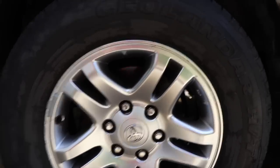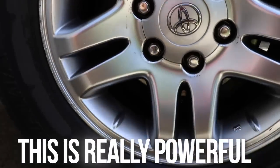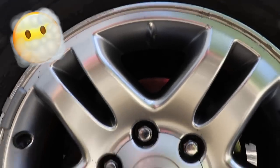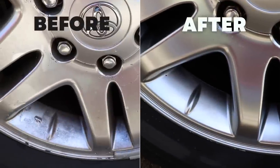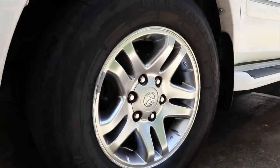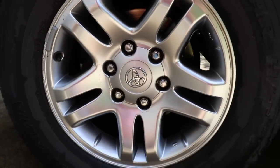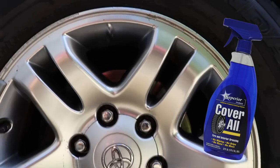Looking at the final result, I want to make a couple of comments. Number one, for a non-acidic wheel cleaner, this is really powerful. A lot of people don't like using an acidic wheel cleaner like Meguiar's Wheel Brightener because it has hydrofluoric acid in it and can be very dangerous for health reasons. I professionally really don't use Meguiar's Wheel Brightener much anymore because of that — a little more concerned about my health these days. So having a non-acidic wheel cleaner this powerful actually fixes a huge problem for detailers, because generally we want the acidic wheel cleaner for the power.